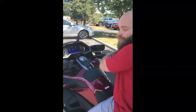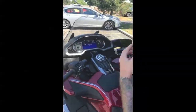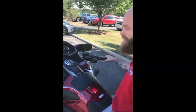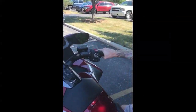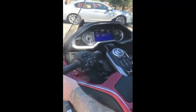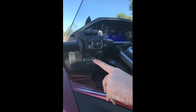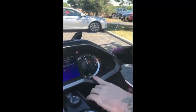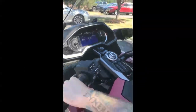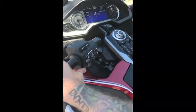The first thing I'm going to show you is the walking modes that come with the DCT. The standard model does come with a walking mode for reverse, but the DCT comes with a forward and reverse walking mode. Very simple — I'm just going to apply pressure on the front brake, and down here there's a button that will show you forward and reverse. When I hit this, you'll feel it and then you'll see the annotation up here. For reverse, I'm just going to hit the negative button, the minus button right here.